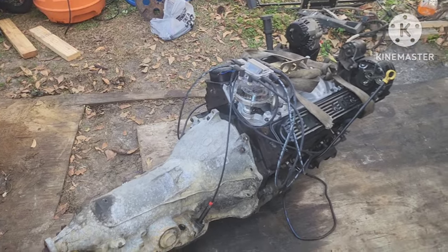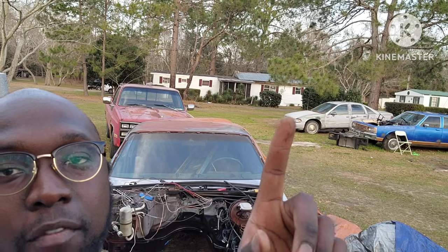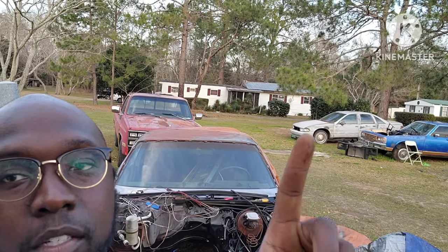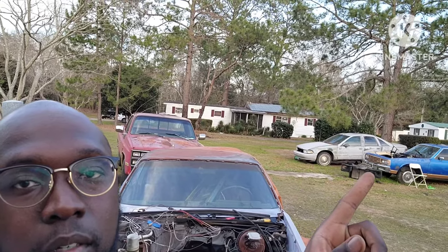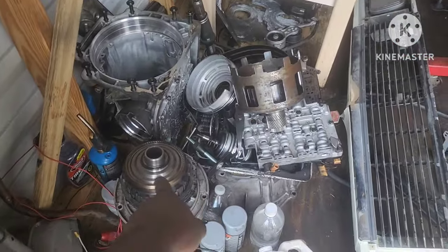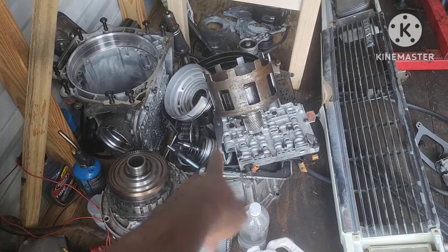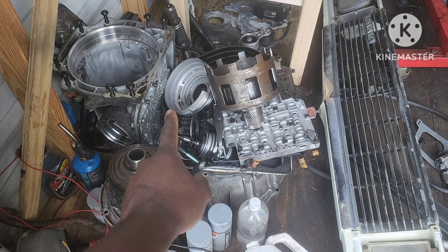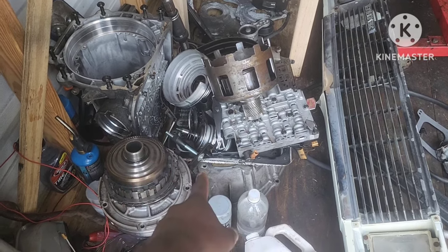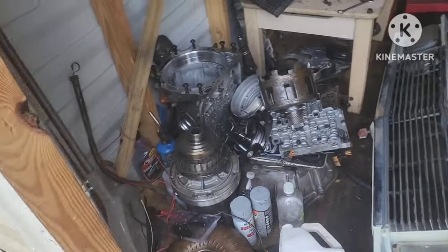This is what we're gonna do — get this dropped in there. Make sure y'all like, share, comment, and subscribe. Also got a posi rear end update for the '91 Caprice, so we're gonna get her back on the road. And I gotta start the build on the box Chevy — I've got my 4L60E right here, already tore it down and checked all the parts. Mainly gonna replace the sun shell, rear planetary gear, Corvette servo, and get some Raybestos performance red clutches.